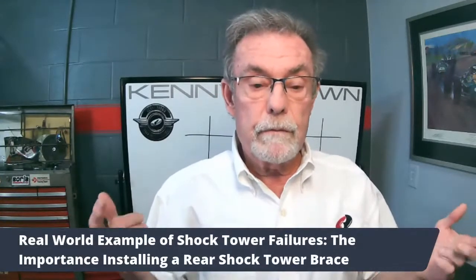Now the centrifugal superchargers like Vortech, Paxton, or ProCharger are kind of like mechanical turbos. It's like a turbo compressor driven by a belt off the motor. For that, I prefer air to air, where the hot compressed air goes through the heat exchanger and comes out cool and into the engine. In motorsports and racing, all we ever use is air to air, but most of those cars are turbo cars. So for the track cars that do use a supercharger, preferably for a Mustang on track, I much prefer centrifugal.